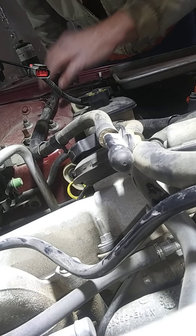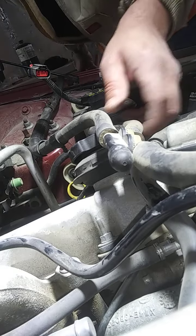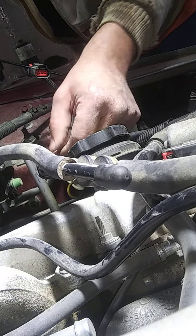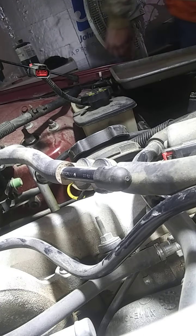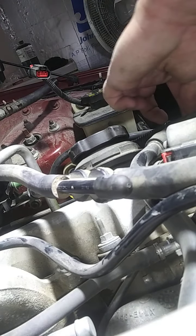Hope that's picking that up. Smoke's coming out around, I believe it's this hose right here. If I move it a little, I don't know if you'll be able to see it any better that way. Let me look. I believe it's leaking around into this valve and these little gaskets, or around these hoses here, which turn in there fairly easy. No hose clamps. There's a hose clamp right up the line up here, but nothing on these. And nothing down here. So they get hardened and brittle, and then they start leaking.